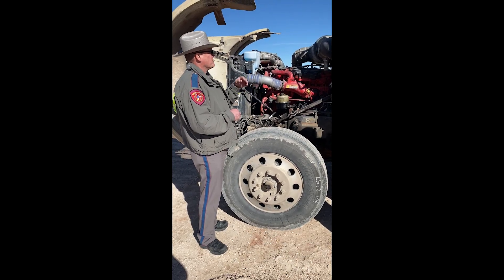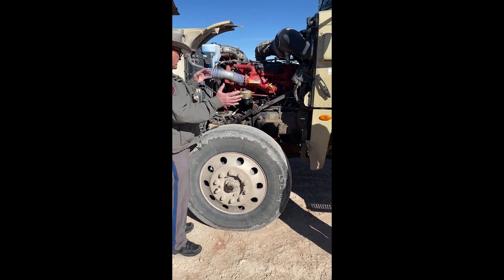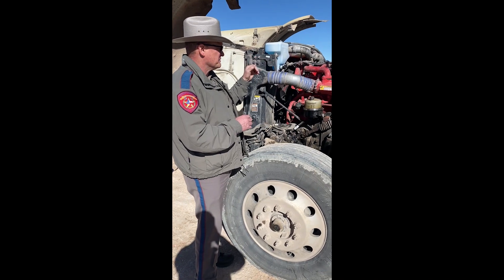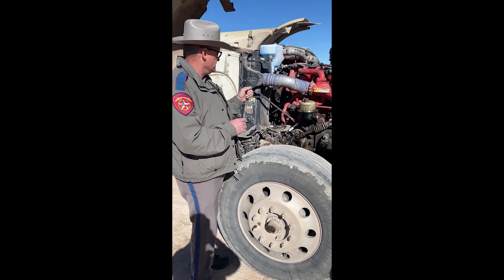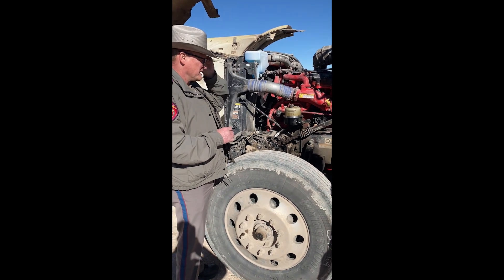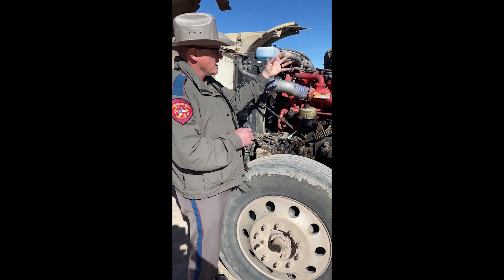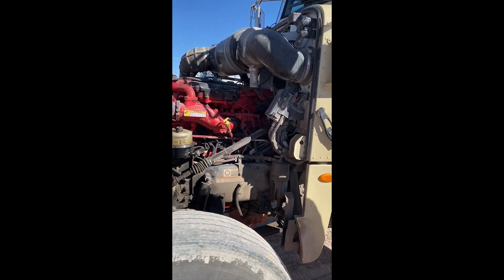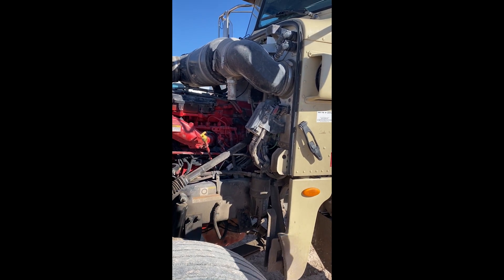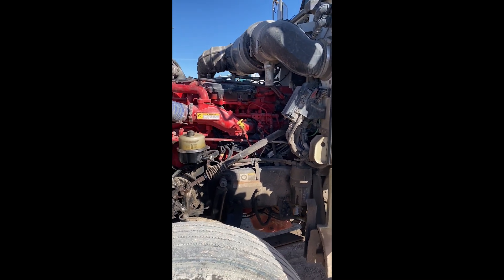As they're doing a pre-trip, or we're doing a level two inspection looking for things, it's always a good time to go in while the hood is open. They're going to be checking oil and fluids, but as they're in there, we're going to look and listen for certain things. At the top, all the way up to the firewall, we see a lot of common air leaks at the firewall on connections, especially with splitter valves. That's something drivers can check if they hear any looseness.